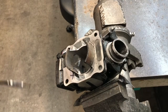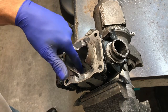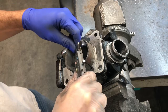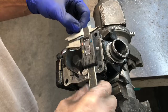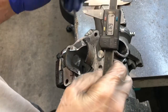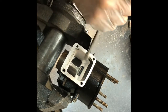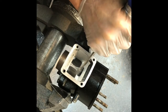Just finishing roughing up the windows to the size I want them. I try to keep the bridge — the intake bridge — between six and seven. I don't like going below six, you start having issues. So I always take the calipers and get a measurement on it, then make them both equal. Just doing some finishing up in this intake of the Banshee, doing the center bridge, getting it all rounded out.